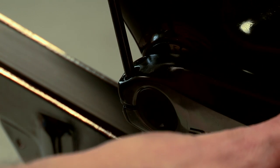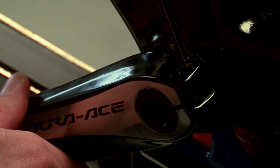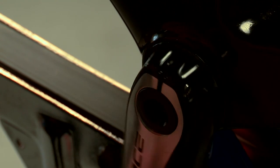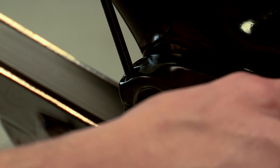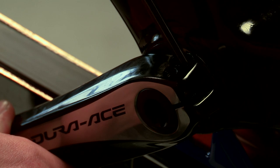If you're satisfied that they're tight, you'll need to tighten the two outer crank screws clockwise. If these are old cranks that you're putting back on, it's a good idea to put some chain lube on these bolts before you tighten them up. Also, tighten each bolt up a little at a time in stages — if you completely tighten one without tightening the other at all, then you risk damaging the crank.